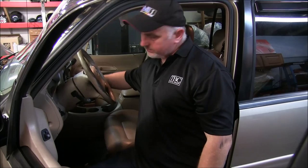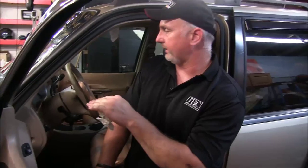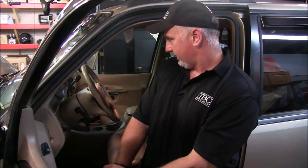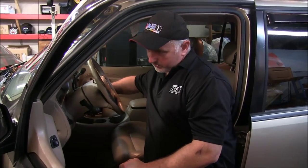After you've installed the oil and put the oil cap back on, let's go ahead and crank it up. We'll let it run for 10 to 15 seconds, or until we see that we have oil pressure, or if we have just the oil warning light, to make sure that it goes off. And it looks like we're there — we definitely have oil pressure on our gauge, so let's switch it off.